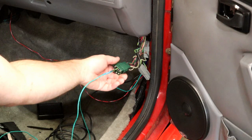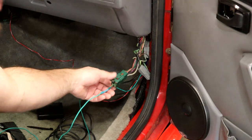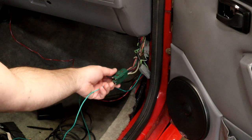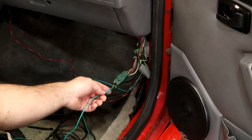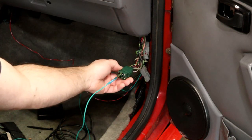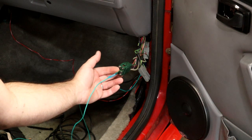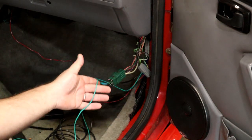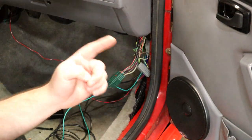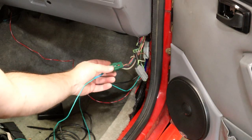Here's the harness I'm referring to — this green plug is located in the kick panel. We just snipped off all the additional wires and we'll tape this up. This one wire here is the Holley wire — you can see the end of the green with the yellow tracer wire. It's a pretty good size wire that runs all the way back to the inertia switch. Once the inertia switch has power, it allows power to run to the fuel pump, therefore activating everything once the key is in the on position. There are actually two wires coming out of this pin spot — one runs from the EEC harness, and the other runs from this connector all the way back to the inertia switch. So for 92/93 owners with a low-demand fuel system, you should be able to run the Holley solid green wire to the solid green with yellow tracer wire in this green plug — still keeping it serviceable.